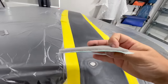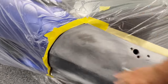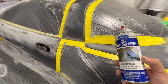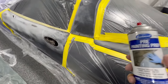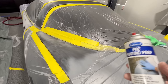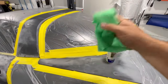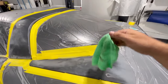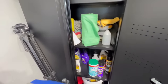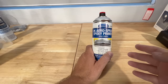This is a hand interface pad - like a little cushion that helps you be more nimble in those areas. Once it's all sanded down it's ready to clean off. For cleaning we're using a pre-painting prep to remove any contaminants still in the surface - you always want to clean prior to primer because anything between the paint and new material can cause adhesion issues. I'm using microfiber tear-away sheets like paper towels on a roll - they're great because you can reuse them a couple times then toss them. You can even get them at Walmart.